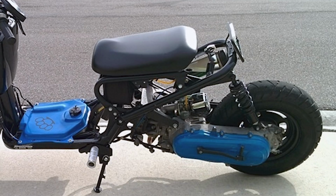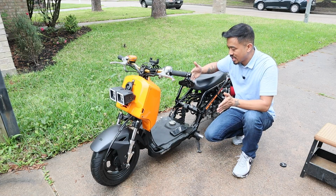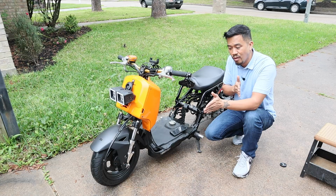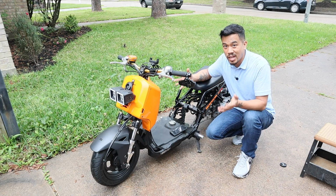You have a skinny stretch, which takes out the tire and then just scoots the engine back, and it's the same offset, moving it backwards, keeping the skinny tire centered. And then there are fatty stretch kits, which stretch it out backwards and then move the tire over to set the offset for a fatty wheel in the back. There are several types of stretches.